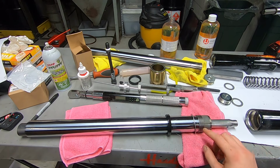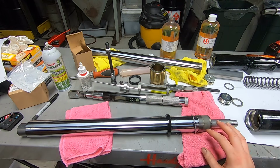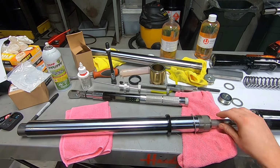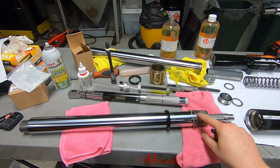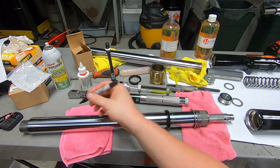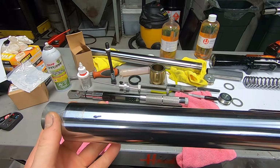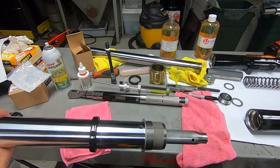And then I saw another technician doing this where the gaps are. I like lining the gaps up. So essentially the gaps will not be on a thrust surface. I'm sure it doesn't make a difference. When you pull them apart, they come apart in all different directions, just like piston rings, but just a little added attention to detail. So I'm gonna put my gaps right there on top. And then just so I can see it once I assemble everything, because this bottom one won't really move. Like it will stay with the fork tube. This top one will spin around until it gets installed. So we'll just line them up like that. So when I go to pound everything together, I can keep them in phase together, if that makes any sense. You see, so there's the line that I made, and it corresponds to the way that I'm going to install all of this together.